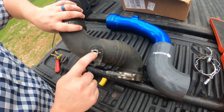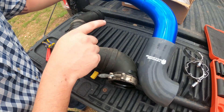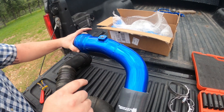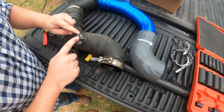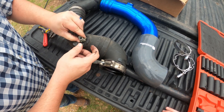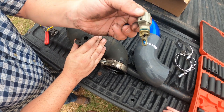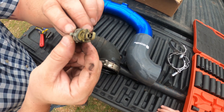One thing I want to point out is the sensor on your old one needs to be taken out and relocated over here — it's in a slightly different spot, but there's plenty of slack underneath the hood. To get your sensor off the old one, all you do is slightly lift up on this little tab, turn it about a quarter of a turn until it stops, and then pull it straight out. Make sure you don't touch the sensor element — you can clean it if you want to.